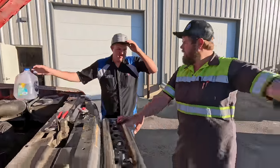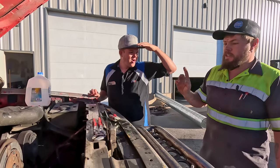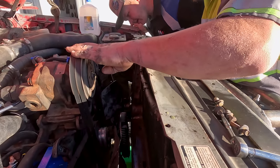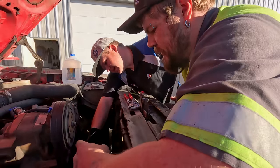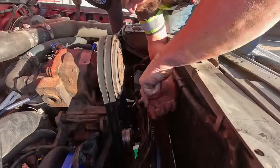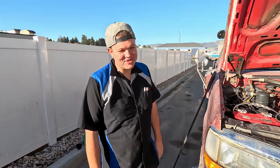It was the fan. That means we've got bad motor mounts - there's about that much movement in the transmission up and down. But notice how big that spacer is that they put on to mount this pump. The belt smacks that, but the belt doesn't ride on it - it's merely a spacer. There are four bolts that hold the fan assembly onto the water pump. We needed this fixed like yesterday. We have to go to the top of Hanging Tree.